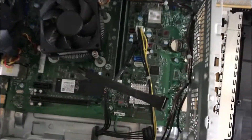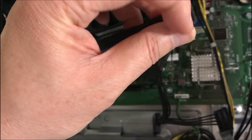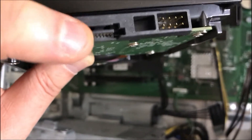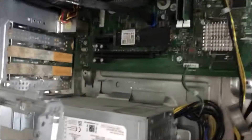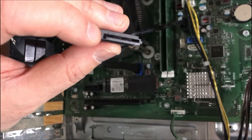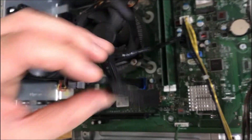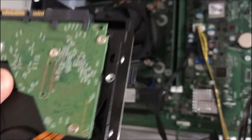Let's have a look inside the computer case. This is the SATA data port — you can see there's a little L-shaped part right here, and that will match with the hard drive side right here, so they go together. For the hard drive power cable, it will be this one — it's already connected to the motherboard. You could use either one of the two, whichever you like. There's also a directional notch, kind of L-shaped, to prevent you from making a mistake. On the hard drive side you match it with that part and connect them together — that's how the hard drive gets hooked up to the computer.